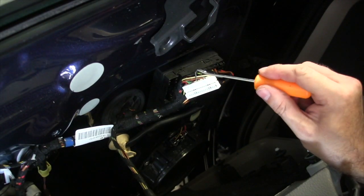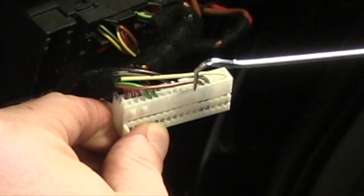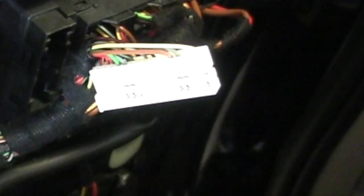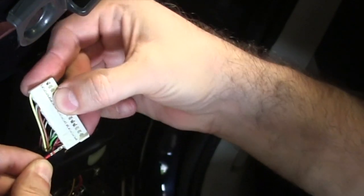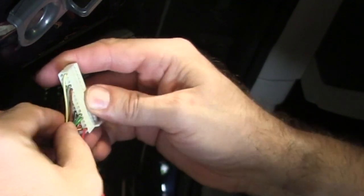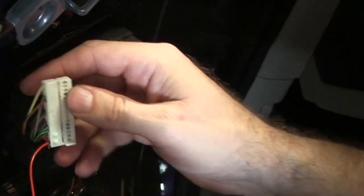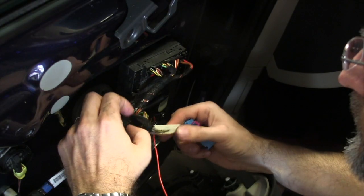I believe the brown wire is the negative. Looks like there's a little number 16 down here: 1, 2, 3... 16. Okay, so pin 16 — that's where we need to put the red wire. So pin 16 is positive, that's where the red wire goes. Yeah, it's in. Now the brown one — they even make it brown. We can't take that connector off so we need to solder it on here somehow. We'll take the brown one out.